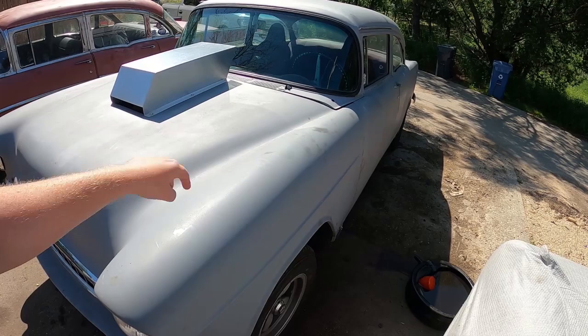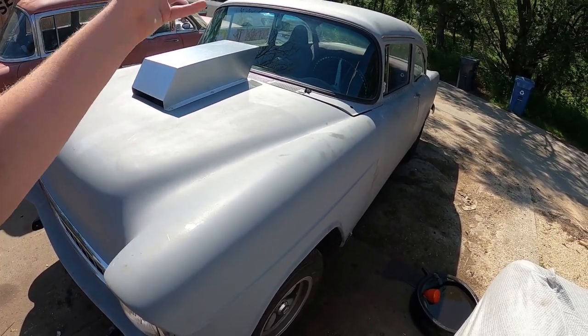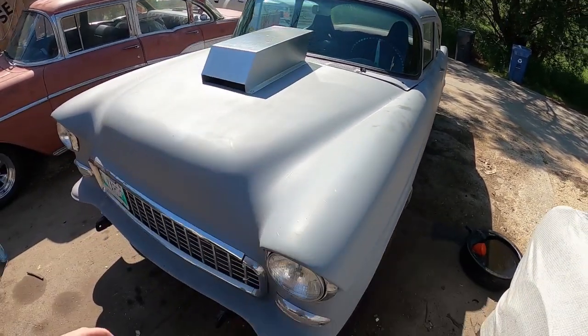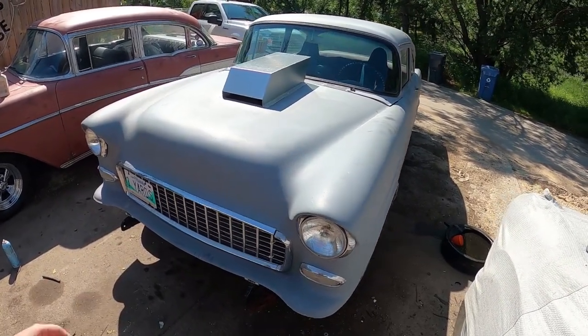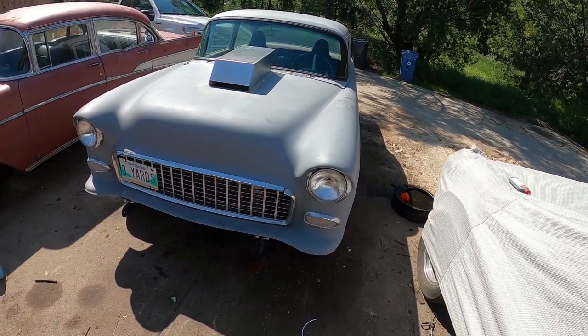But I actually think what it is, I think it's on this side, you hear it clickety-clackety. The fender well headers, when I had them off, the front suspension had whacked in them a few times. I just have a hole in one of the pipes or something like that. So if I can find it, I'll just give it a quick buzz with the welder. Otherwise, maybe it's just a gasket. We'll see what happens. But do that, clean it all up.